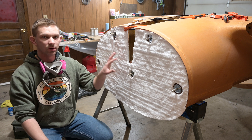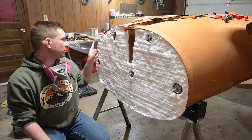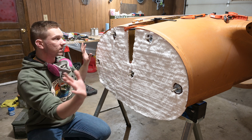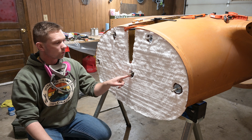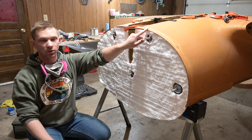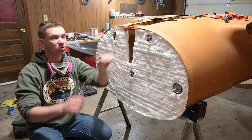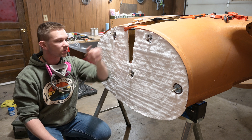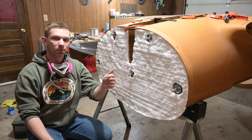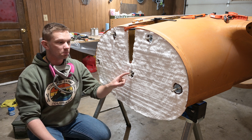I've got this temporarily held in with some 3M double-sided tape, which didn't work very well, a clamp, and it's kind of just shoved in there. The firewall is mostly dry, so I'm going to go ahead and set the firewall on here. One issue with my washer modification and having more of this blanket is that I might run into issues mounting the cowling because this is going to push the firewall out a little bit, and there might not be enough edge distance for those screws. I'm also going to need to find a way to extend this lid, and I think these bolts are going to be too short.